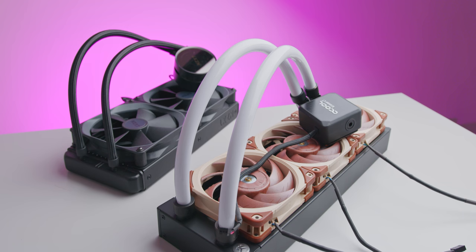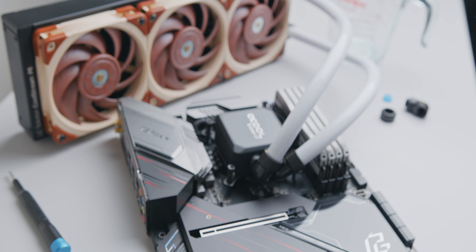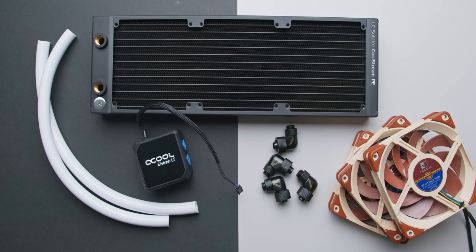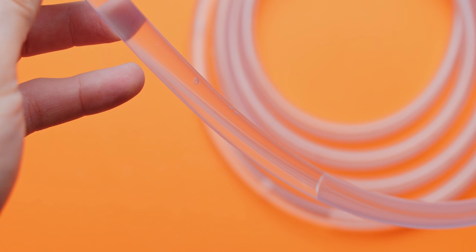This project is completely modular except for the pump block, and that's the funnest part — especially when you start to consider the possibilities for huge high-performance radiators that you just can't get in the form of an off-the-shelf liquid AIO. I did some quick thermal testing on a 9900K overclocked to 5GHz at 1.28 volts and thermals seem to be right where we expect for a high-performance 360mm radiator. The modularity is the real king here, seeing as you can customize this to however much cooling performance you require. Although this project does not make sense for a regular gaming build constrained within a tight budget, I do see this making sense for workstation builds, especially those running higher-end processors and requiring a bit more thermal headroom. Although it is technically a custom loop, there's no need for a discrete pump and reservoir, and the setup is a lot cleaner, simpler, and quicker. If you're interested in building something like this, I will leave all the links down below to everything that you'll need. As always, a huge thanks for watching and I'll see you all in the next one.